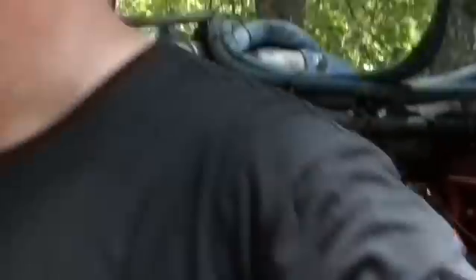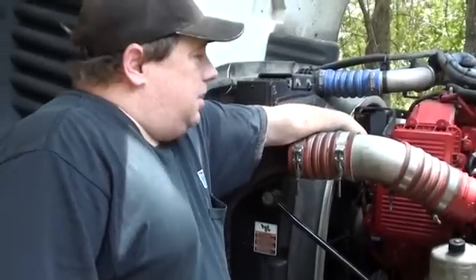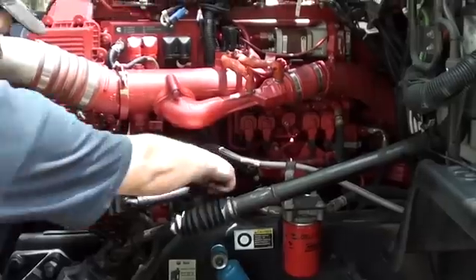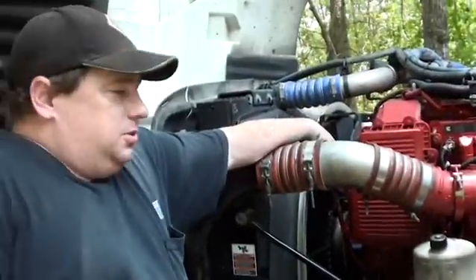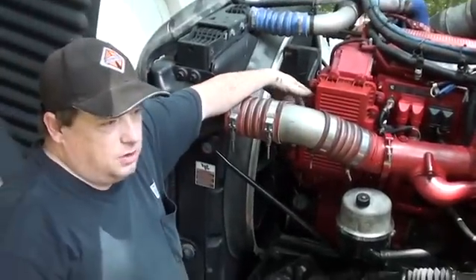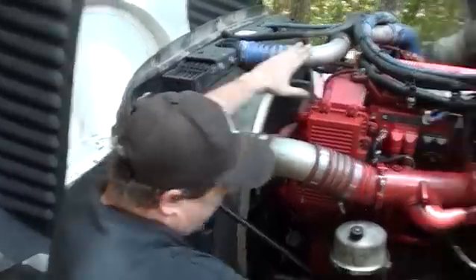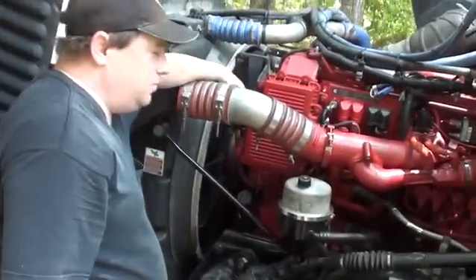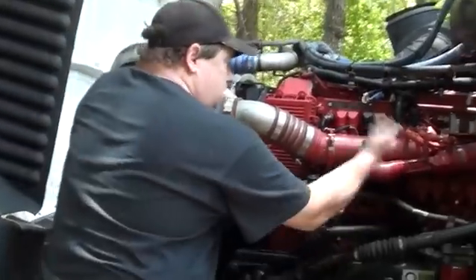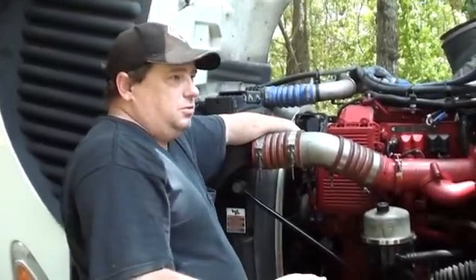I don't know exactly how other shops do it. What I did was take the dipstick out — the dipstick tube is basically the same size and length on both motors. You can't just plug all the holes and check crankcase pressure because it'll build pressure endlessly. You need some relief somewhere, then a place to check pressure against that relief. So we pull the dipstick out and use that as the system relief. It's got a set size hole and tube distance, giving us a consistent baseline from one truck to the next.